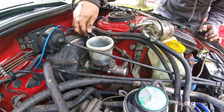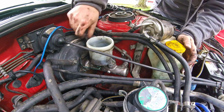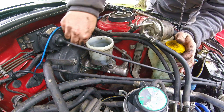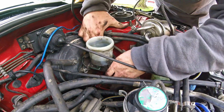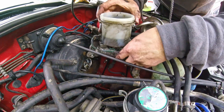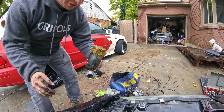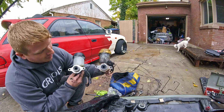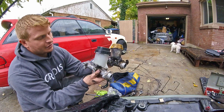We're going to pull off that sensor — pulling it off gives you more space to get into the back bolt. Pull forward and try to pop those brake lines out and it'll pull straight off. Now at this point it's always a good thing to grab the one you're going to replace it with and check to make sure they're the same thing. Mine is crazy dirty obviously, but besides that they're the same.